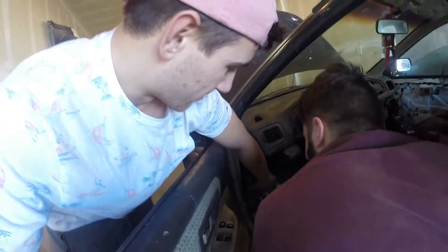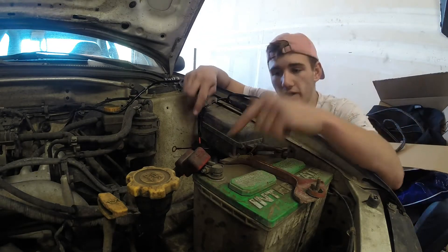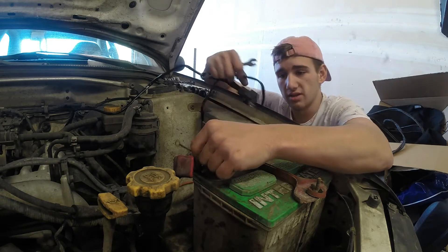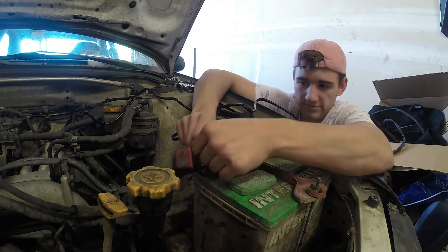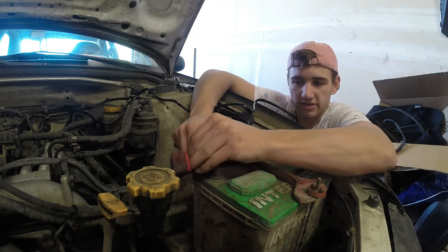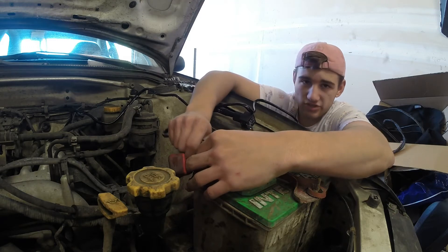When you're wiring your light bar, you just go to your battery terminal — there's normally an open bolt there. Take it off and connect your positive to the positive. You normally want to put something over it, or at least a washer, just to make sure you don't over-torque that copper piece of the light bar because it's not that strong. Then just torque this guy down.